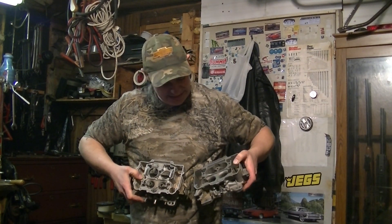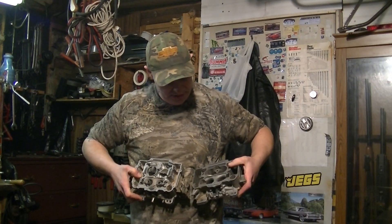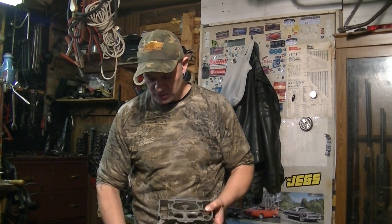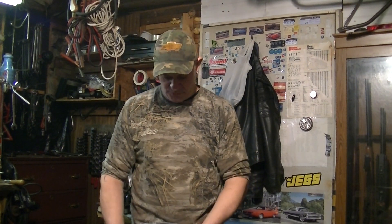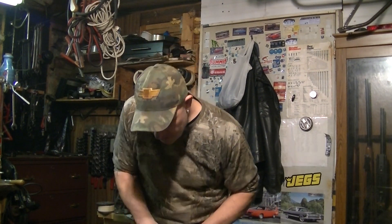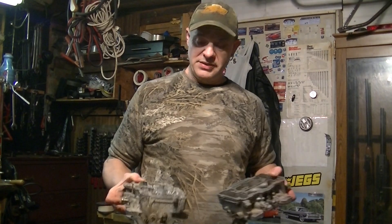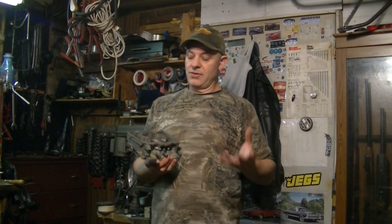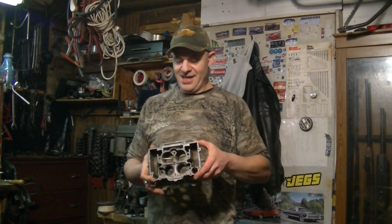The back of it isn't as open because it doesn't have that weighted air valve. So if you look at these, you'll see that this one is much smaller physically — even though the base of them are pretty close. From float to float they're actually almost the same, but this one is wider, and this is quite a bit heavier because of the air valve and because the base is bigger. So this does have one advantage. And people would say, well, I'm crazy — why are we going to use a 1966 carburetor? Well, probably because I am crazy.